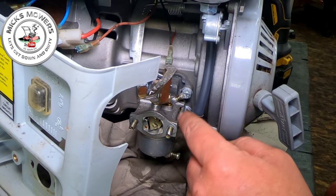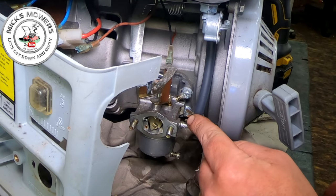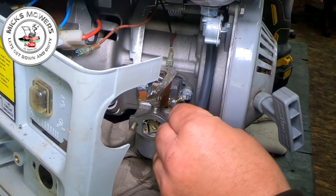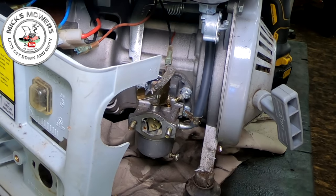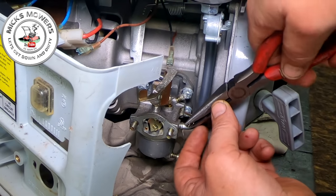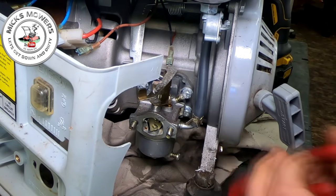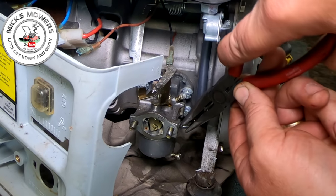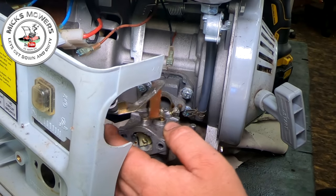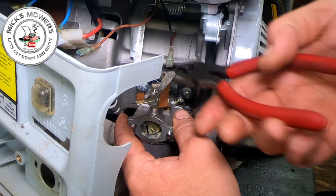To remove this carby it's quite simple — it's already been loosened off because of the bolts I removed anyway. You've got a fuel line to remove just here, a governor spring to remove just here, and that carby should just pop off. We're going to move this clamp first — a pair of long nose pliers will do that quite well. It would be the wrong way around so let me just bring it around a touch, get hold of it. Lift that up, off comes the fuel line, and you've got a little tiny governor rod here.